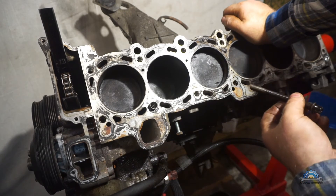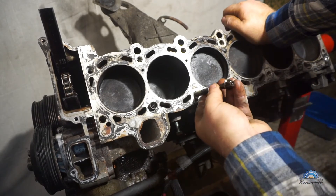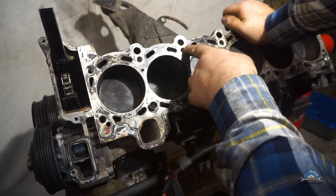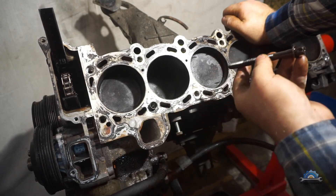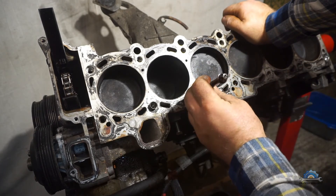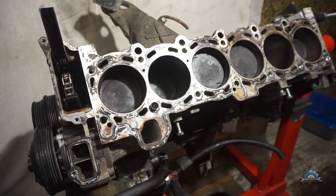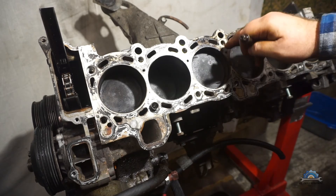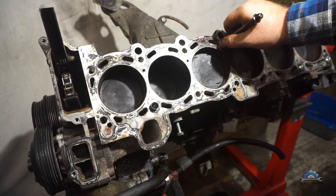Another thing: if you're installing new bolts back in, you want them to be lubricated for a smoother action and to help cool down the threads, so that the torque settings — torqueing down the head — can be applied without any problem. There will be no squeaking or terrible noise when you're torquing down the head bolts. It's a lot easier with less risk of overheating and having trouble with pulled threads.